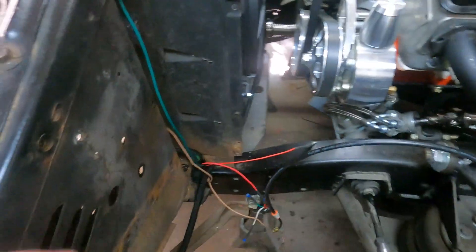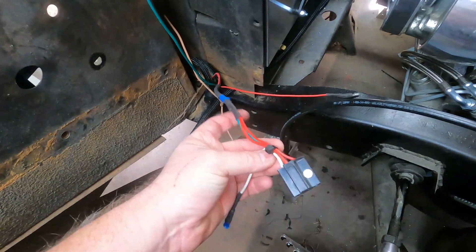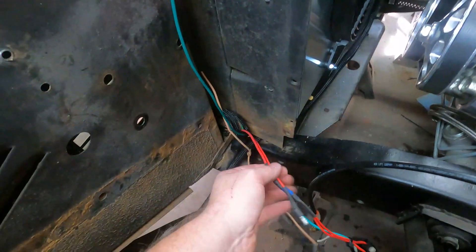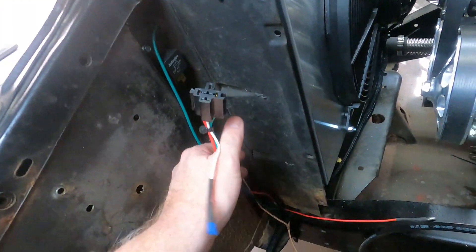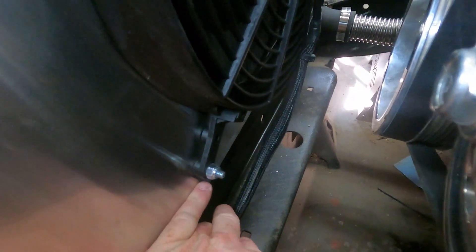That's reasonably simple. It's a quick way to wire it and a quick way to get that 12 volts off of a negative trigger. Next steps for me — I'm going to wire this here in just one second. I already have my wires laid out. I used bullet connectors, shrink wrap, and then one of the pigtails. My relay is actually already hiding in here; I just need to clean up some of my wiring and make my final connections. I also used a split nylon braid — you can just pick that up off Amazon.